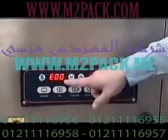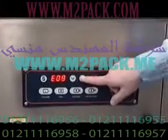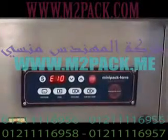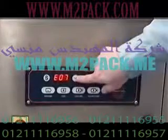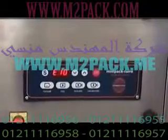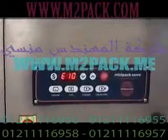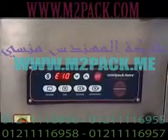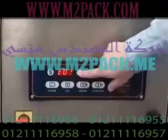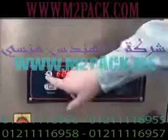What this particular feature does is it allows me to extend the amount of time that it's going to suck that air out. Typically, once the machine gets up to 99.9, it'll stop and the process is over. But if I add 10 on here, I'm going to have it last for an extra 10 seconds at the 99.9% pressure level. That's if you're going to be vacuum packing food that is porous. One item that we recommend extending the time on would be meat. For this demonstration, we're just going to leave that at 0, which is really all that you'll usually ever need to do. Now I'm going to push this again.